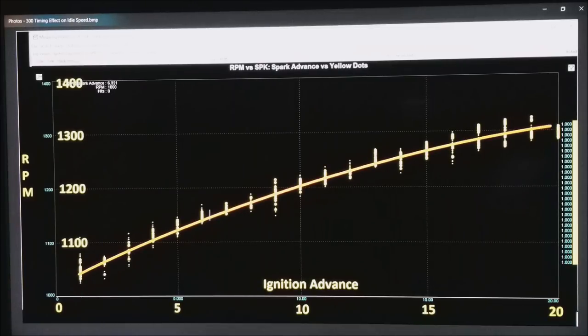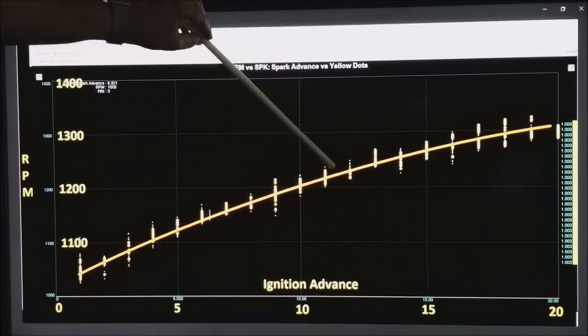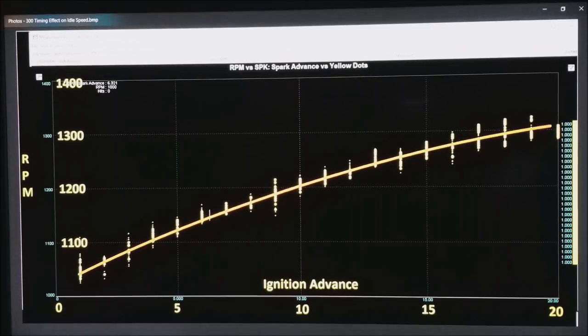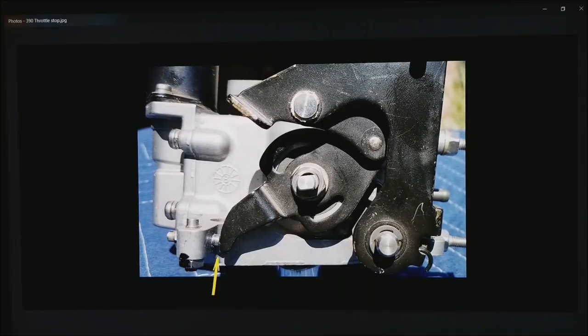You will have to test your motor to see where the sweet spot is. But if we idle this motor with an aim of about 10 to 10.5 degrees, we can adjust the timing to affect the RPM — and that happens instantaneously. It is not like an idle air controller, which is very slow at reacting. This throttle stop adjusts the slow-speed idle, or the amount of air that gets past the throttle plates.